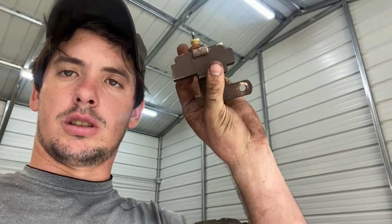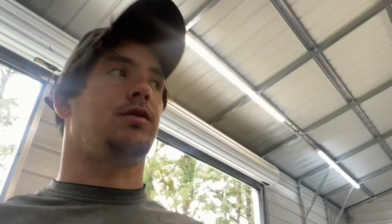They go from the master cylinder to the pressure differential valve, what they call it for a drum brake car, because it doesn't actually change any pressures, and then it goes from there to each wheel. I got the old ones broken out. I had to break most of them off to get them out. We're gonna throw them back in, see if we can't bleed these brakes. We're gonna finally drive this thing.